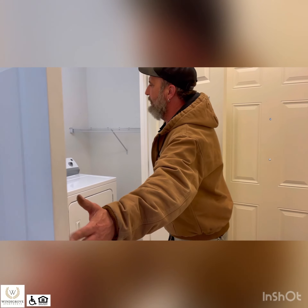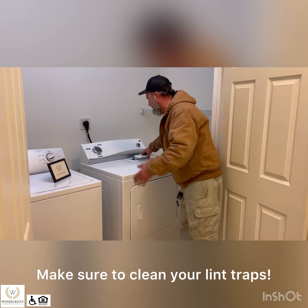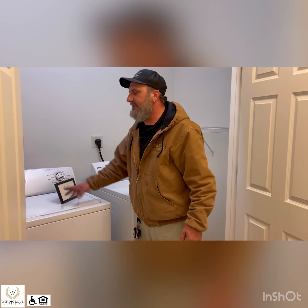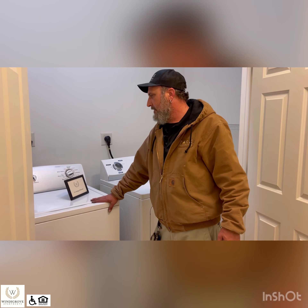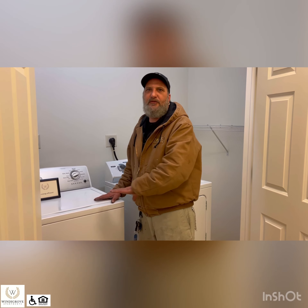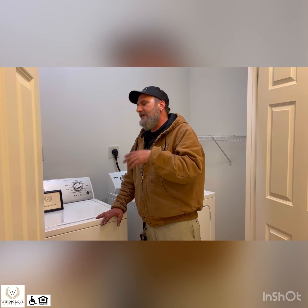We open up both doors and you've got your basic washer and dryer. The dryer is just basic — make sure you keep your lint filter clean. The wash machine is high efficiency, so you can use high efficiency powders. It does have a sensing mode, so when you first put your clothes in and start it, it runs a sense mode so it doesn't get off balance and make a lot of racket. Usually takes about three minutes to sense. If you come out in about five minutes and notice it hasn't started, just lift the top up, rearrange the clothes, and close it. Everything should start off and work fine.